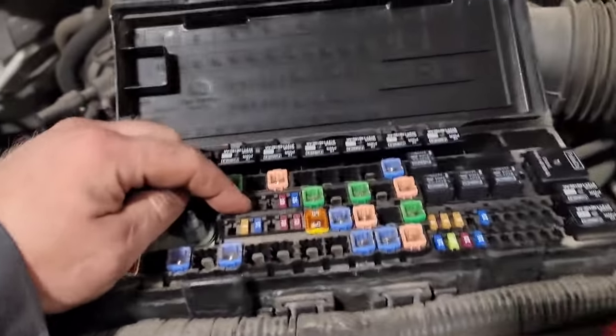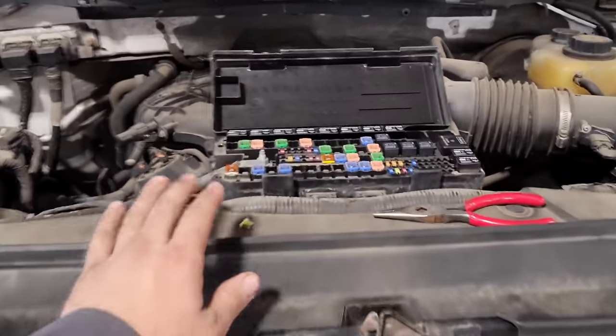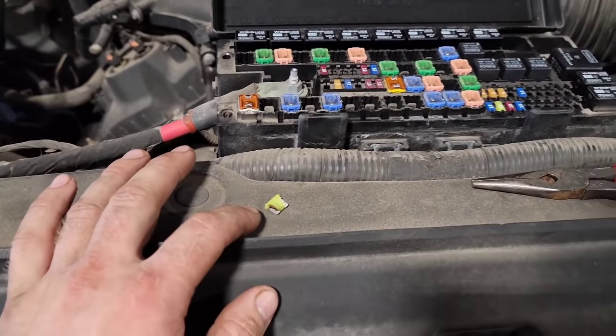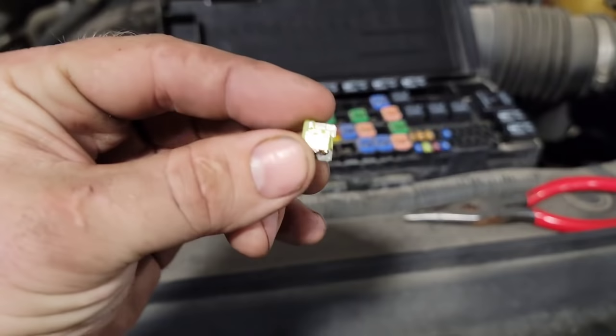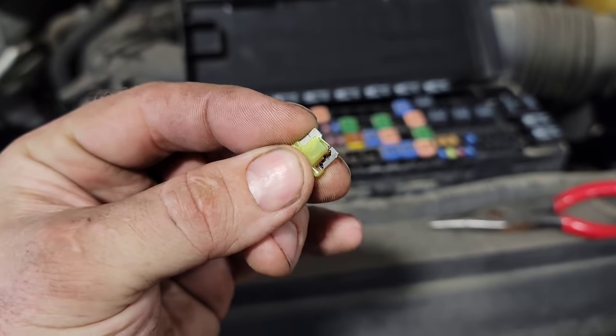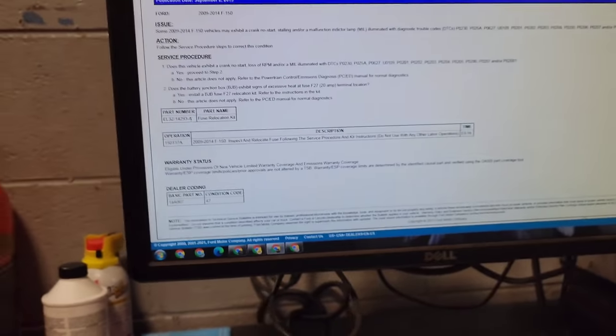This is the number one and number two reason, and then the purge valve would be like number three, number four. But this would be the main concern first, because this is the only code set for the fuel pump circuit. So it's probably making just enough connection to send enough power back there, but it's burning it up. And we need to figure out the relocation kit for it.